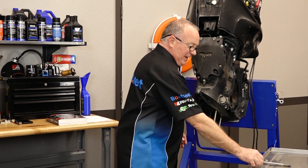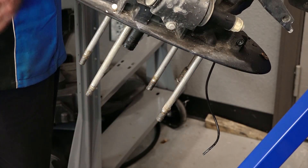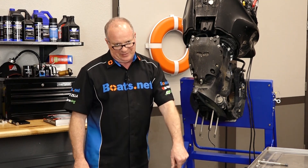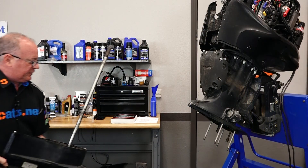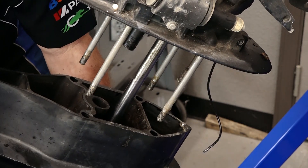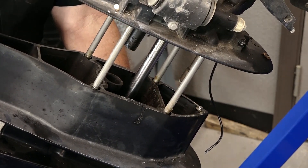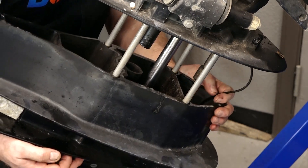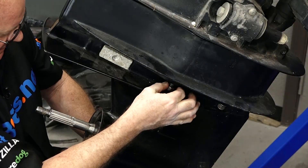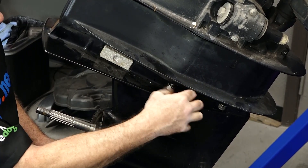When we bring it over, we're just gonna get one of these on there without the washers. At that point we can shimmy it the rest of the way up, then go back, add a washer, and then bring it up into position. Now the real challenge here is this little speedo tube that's all the way at the front of the lower unit. And the real challenge with this one is it has that extension on it, so I have to get my hand down in there and kind of do it by feel. Make sure we're grabbing it down low far enough. Let's hold it there for just a second — she's pushed in. Now we can bring it up. Align your shift shaft. We've got one holding it in place.